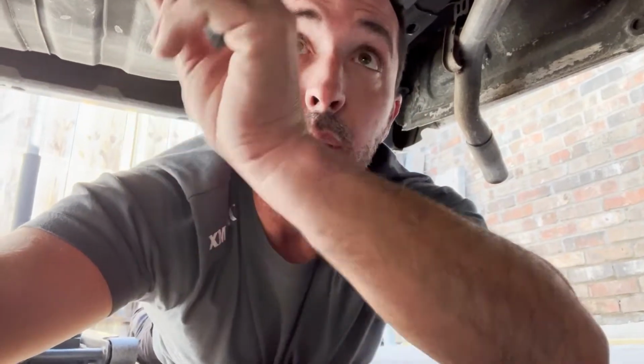The first thing I'm going to do is just get wheels off, get all the brake calipers unbolted and pulled away, get the discs off each side. Then I will pop the cover, drain all the fluid that was brand new, and kind of start over. And then I can pull the axles out and start kind of moving stuff around and see what I've got.